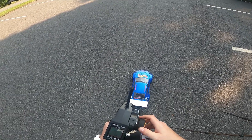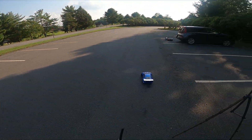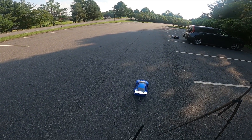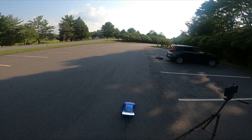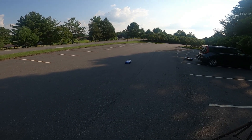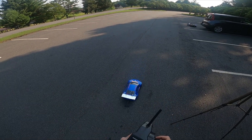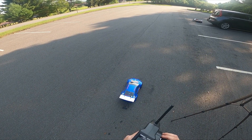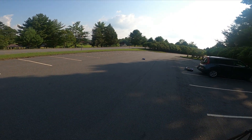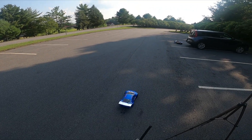I'm gonna get my foot on there. Got a little better burnout, a little more heat in the tires there. Let's see if we can get a little better launch. Dead left. I'm beginning to wonder if we don't have a servo going out because the steering is wandering so bad. I'll add in a couple of clicks of trim — I hate to do that, but if the servo isn't able to find center then that's what we'll have to do.